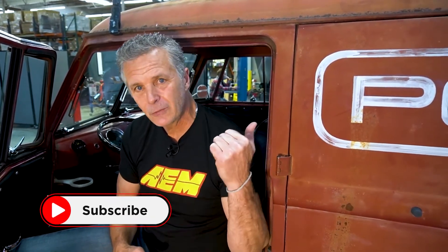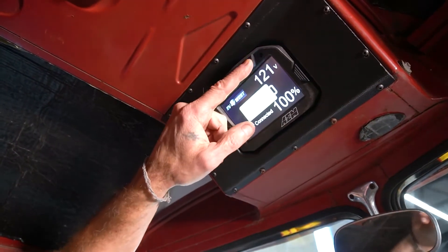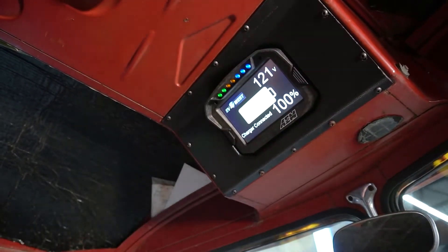Something I think is really trick: when you plug in the J plug, we can have the VCU wake up — it has to because it's working with the BMS. So the system comes up and shows you the charge, the state of charge, the time left to charge, and then we use the shift lights as the overall pack voltage indicator, so you can glance inside the vehicle and see all this information when it's plugged in.